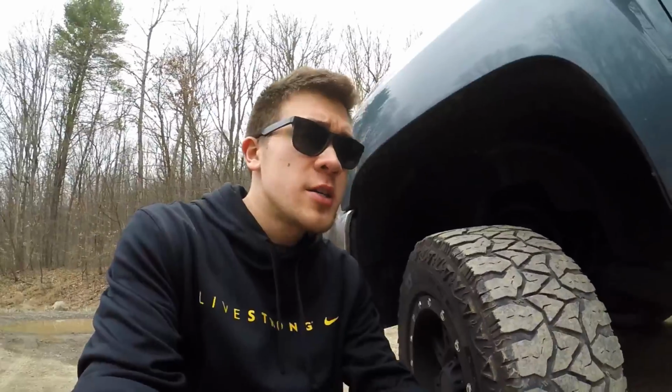Secondly, I'd like to talk about suspension lifts. Suspension lifts are a lot more expensive. Now I have a mid suspension kit, which is anywhere between 3 to 4 inches. People say don't go with those because they're actually a maxed out leveling kit, but they're called suspension kits just to appeal to the people that want to run the bigger tires. And with leveling kits, everyone thinks a leveling kit is small because usually that's only 2 to 2.5.